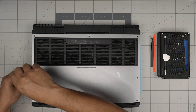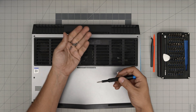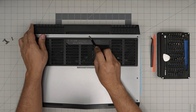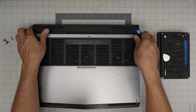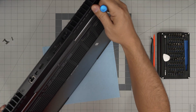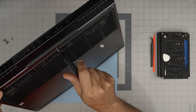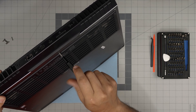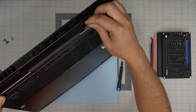The reason I said don't remove that mid-back screw yet is because it has something called a C-lock on the other side. The C-lock prevents the screw from coming out entirely, and it also serves to separate the case from the cover. If you start rotating this screw you'll see a tiny gap opening on the case.